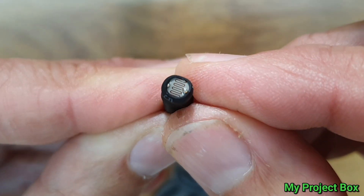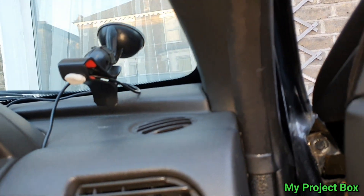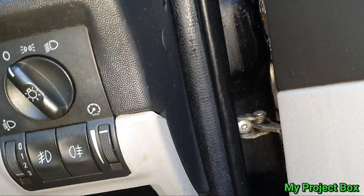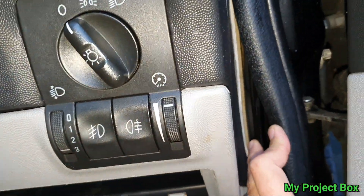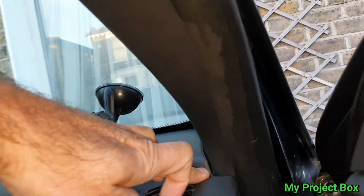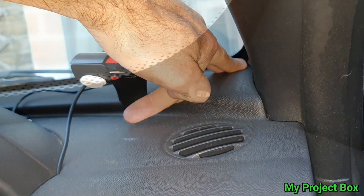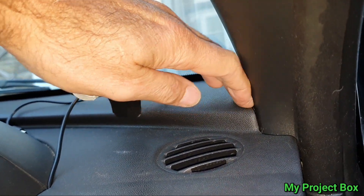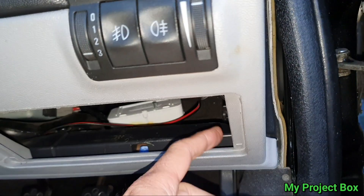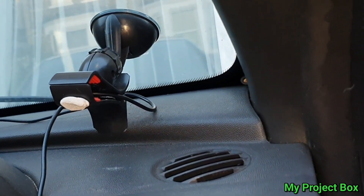To get the LDR wire fished through the dash, the easiest approach is to pull off this bit of trim, which gives access to lay the cable in there. Then poke a coat hanger through so the LDR can sit in the corner of the dash. Use a screwdriver to push the dash apart slightly to tuck the cable down and fish it out down to where the control box is, so we'll have the LDR sitting on the dashboard to sense the ambient light.